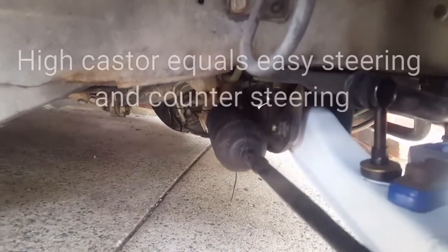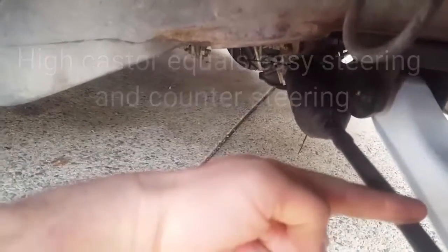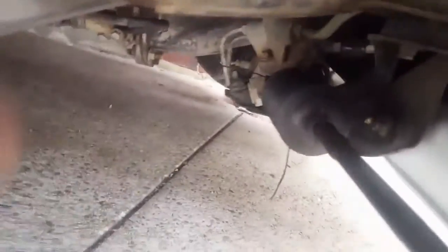The binding is caused by this arm being on an angle relative to the steering rack. The steering rack sits straight and the tie rods are pointing forward, so they're past your center line. Ideally you want all of this to be straight. If I yank this back now you can see that straighter position — that's how you want your steering rack all the time. This modification should bring everything back in line.